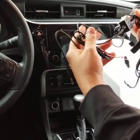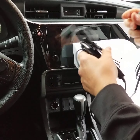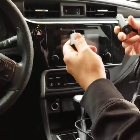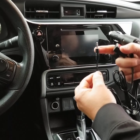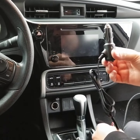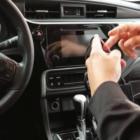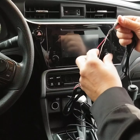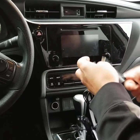This is the CD player adapter. There are a lot of cables here — it looks cumbersome, but this is merely for demonstration purposes. You can tuck all the cables away so you're only left with a few loose connections. We've already spoken about the mini jack headphone connector for audio. We have the cigarette lighter power adapter — if you want a quick installation, leave this connected. Or you can cut the connections and hardwire the CD player to a keyed accessory, which has power when the key is on, and then of course ground, which provides stabilization to prevent shorts or static issues.